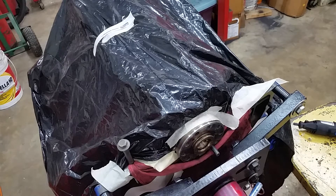To do that I had to drape everything off - this is like surgery or something - drape everything off, tape it, seal it off. Then we're just going to very carefully, taking our time, make sure we don't slip up anywhere. That wear ring is what the rear seal runs on and it's replaceable. They sell a special tool to take it off and put it on but it's like 600 to 800 dollars, and that just seems like a lot of money to use it one time and put it on the shelf. So we're going to do it this way.